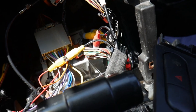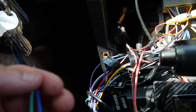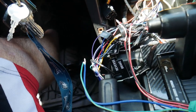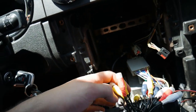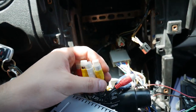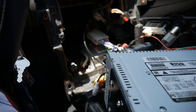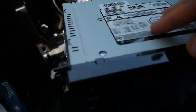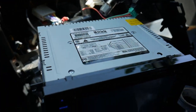I'm going to tape up the ground, the accessory, and then leave the green and blue ones untaped. We now need to run the amp plugs. All right — let's do the test run. Key in ignition — the speakers are coming on! The sub just made a sound!